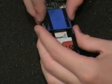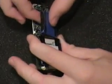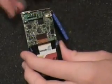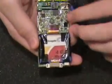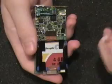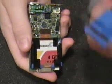That's all there is to the iPod Mini — it's very small. There you see the battery; it's the blue piece. It will be held on with a little piece of adhesive, so simply pull straight up and it will come undone. Now unhook the battery connector. Sometimes it works if you put your fingernails underneath; otherwise you can pull in a circular motion straight up and the connector will come undone.